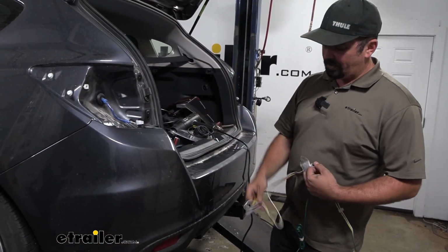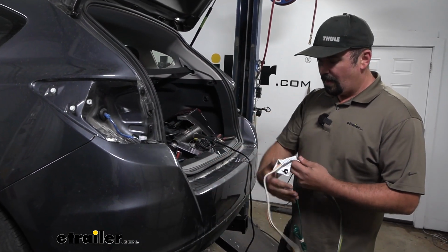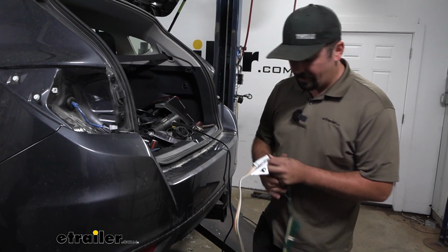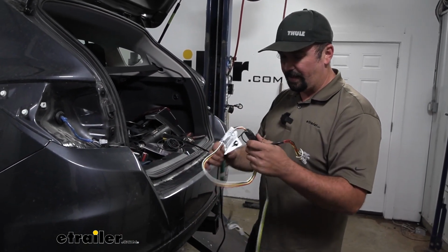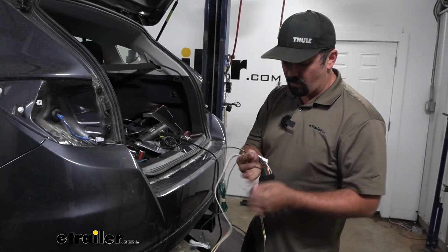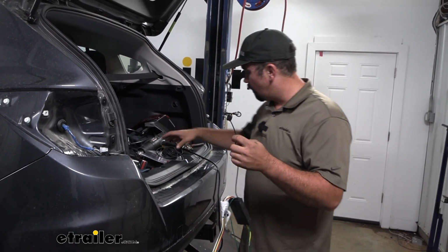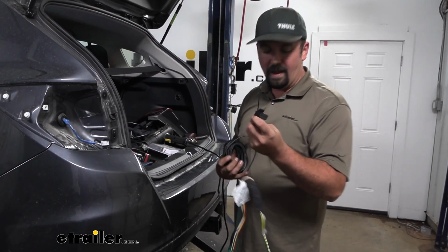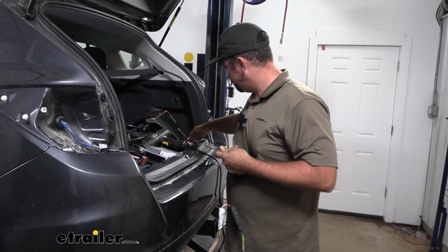So we are going to eventually pull this plug up using a fish wire, and that way we can snap in here. But there is a plastic panel under here that it kind of has to go around, and I do worry that we're going to have it pretty tight underneath to make it difficult to attach our power wire. So I'm just going to do that now. That way we don't have to worry about trying to crimp wires underneath the vehicle. So grab the spool of wire that comes in the kit and the black power wire off the module, and we'll just strip these back.